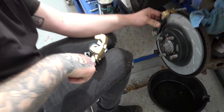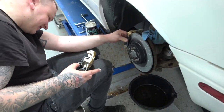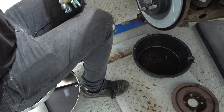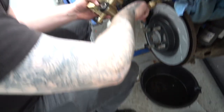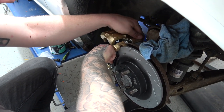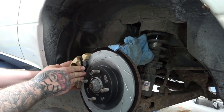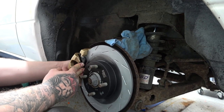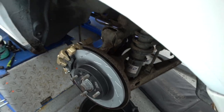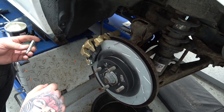Greasing everything up because the sliding pin needs to move smoothly. Those dust boots do not like being on - you literally just look at them and they fall off. Not wanting to scratch the lovely gold caliper with all the bling. That piston feels definitely smoother than the old setup. The piston is tight but it is in - it's just that everything is brand new. Brand new disc, brand new pad - it's all fresh.